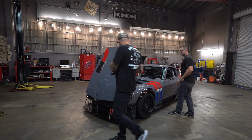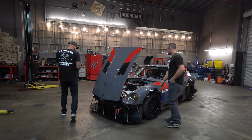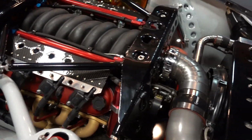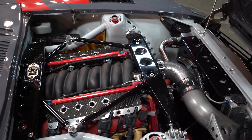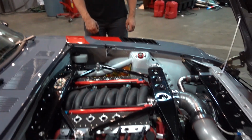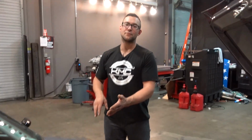Well, this looks great. So this is an LS1, right? LS1, yeah, it's an 04 GTO, so it shares the LS6 cam and intake. But mostly stock. It's stock internals. I've done a few little things here and there. Got rid of the steam port on the throttle body, lightweight flywheel, just a few things and a nice dyno tune. Well, let's be honest, at 2,700 pounds, 400 horsepower is going to be more than enough for this thing. Yeah, 347 at the rear wheels, 383 foot-pounds of torque right now.